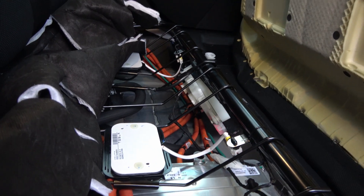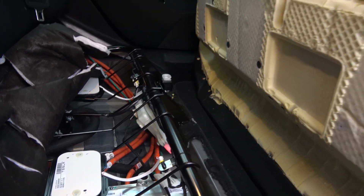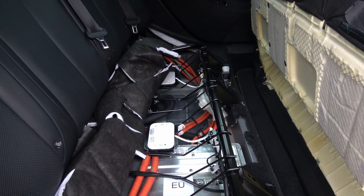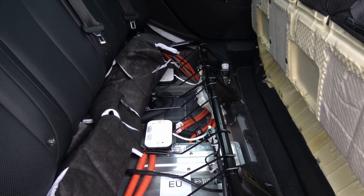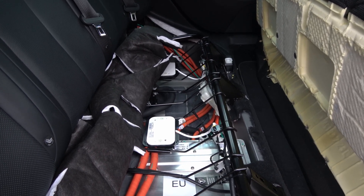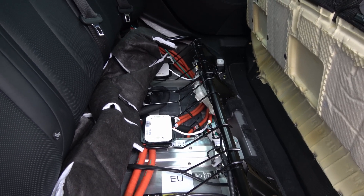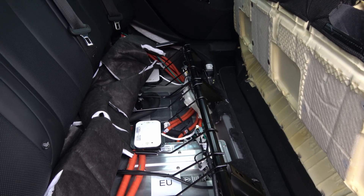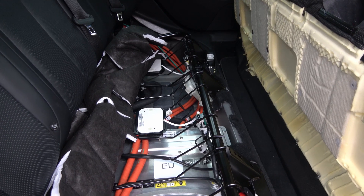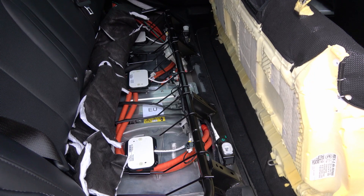And there you see that red blinking device. That is what they attach with the charger, and basically what that does is it provides the handshake. It doesn't influence the charging in itself because it is still DC charging, but that is what provides the handshake with the CCS charger. It's about 15 minutes of work for the person that does this update.